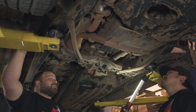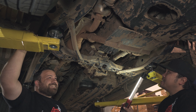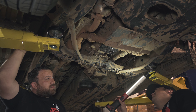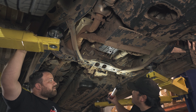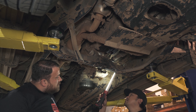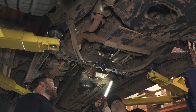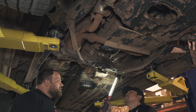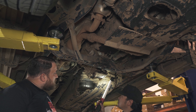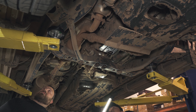There's mud everywhere — still not going to wash it. I noticed that the transmission drain plug is leaking a little bit. That's something easy we could fix, but the transfer case output shaft to the front seems to be leaking pretty bad. That's probably because of the 250,000 miles that are on it. That's something we're going to probably have to service. It seems like everything looks pretty good — I don't see any damage to the rails or anything like that.